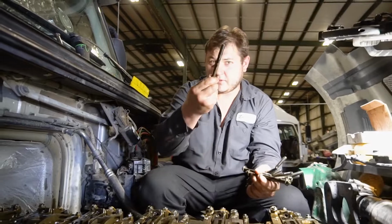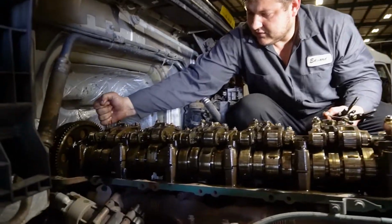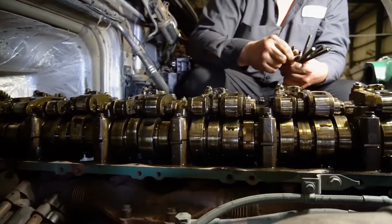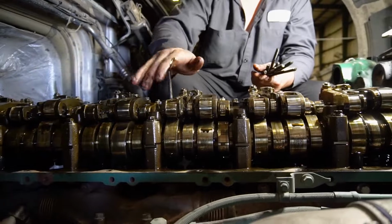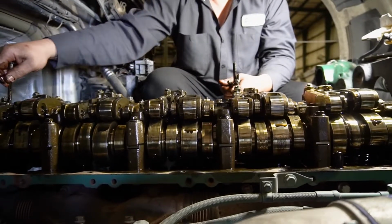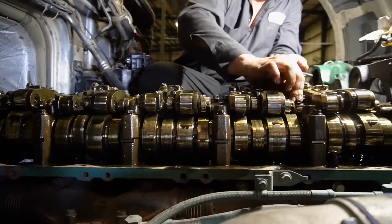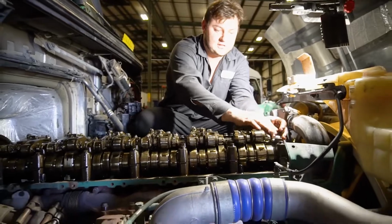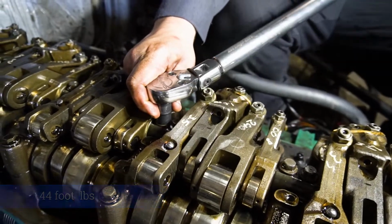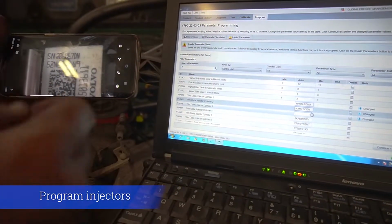You see, put the big one first, right in here. Sometimes you kind of gotta jiggle it. There you go, popped in, popped in, popped in, all in, nice and tight. And we're gonna torque down to specifications. We're gonna do 44 foot-pounds, and there's a procedure on there. I'll show you in the scripts, but this is what you do. You do 44 foot-pounds, and there's eight steps.